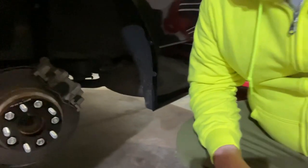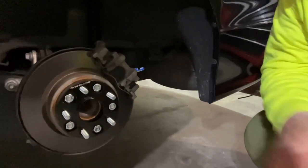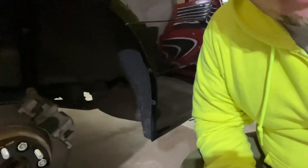This thing's wild. Still learning our gimbal, obviously. So right here, we're test fitting some 25 mil spacers as well. 25 mil, I hear, is the magic number to clear these factory studs, and it seems like it's going to work really well, except that I think the factory wheel was still making contact with the stock studs, just barely in the front.